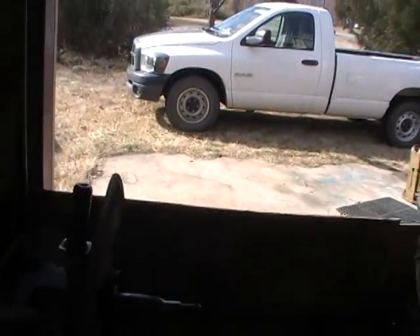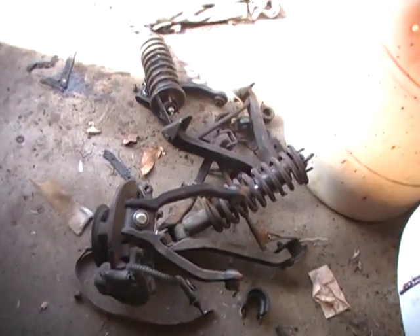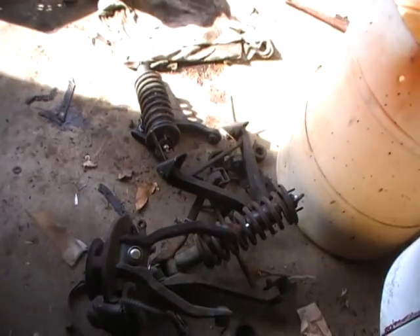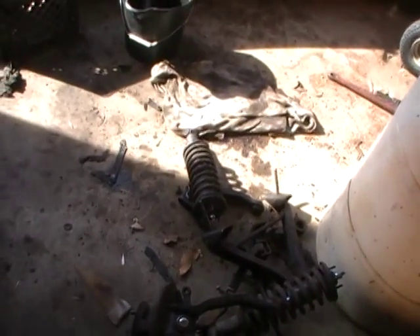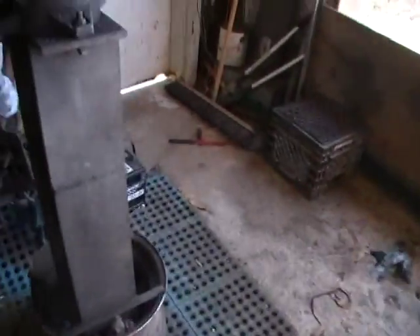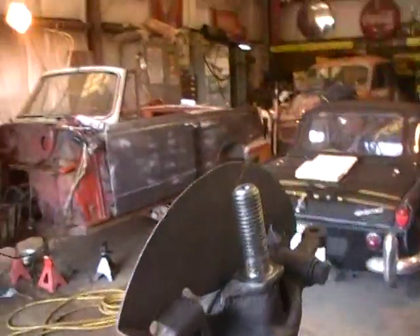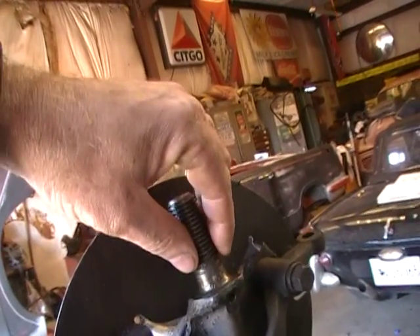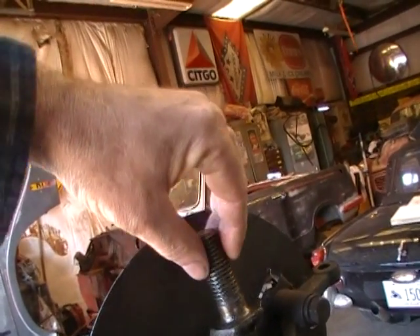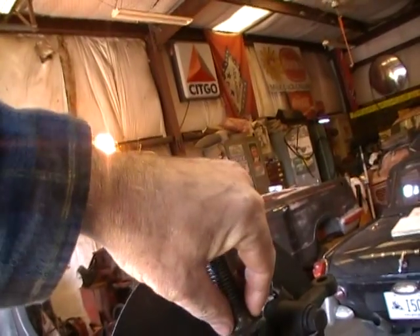While I was sitting down hurting yesterday, I took one of these apart — the one that's going on the car. It had obvious signs of rust in the trunnion area, and I had to cut it apart with my sawzall because the bolts wouldn't come out through the rubber bushings. I was really scared because Scott Best told me several years ago that the trunnions in this part can strip out and drop your car onto the pavement — very embarrassing and potentially fatal. But it was loose, and it's still got good threads.